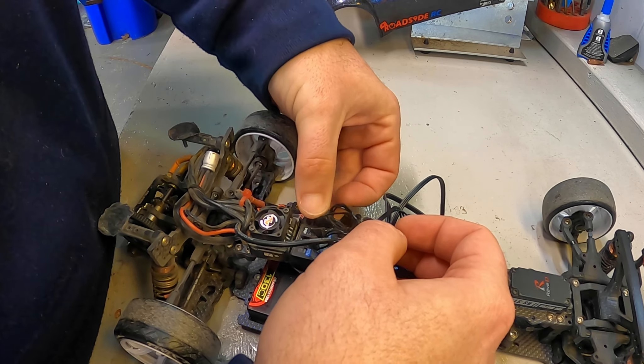The first thing I'm going to test is whether the gyro is working in the direction I want. If I move the rear tire towards me, the steering should move towards me also. We can see we're working in the wrong axis — if I move the car this way the gyro is not moving, but if I tilt, then the gyro works. That means we're working on the wrong axis.